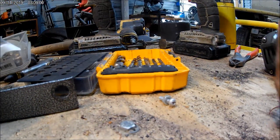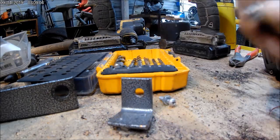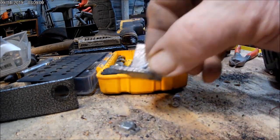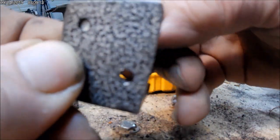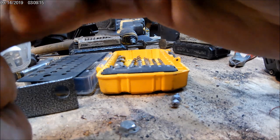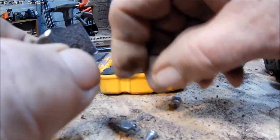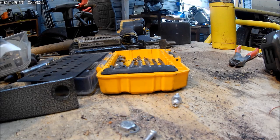What I'm doing here is I'm trying to make a little bracket, a piece of angle iron where I can mount the choke cable to the frame or the body somewhere. And I'm going to rig up a solenoid like a window door lock actuator. They're universal size, so they'll fit anything pretty much. They're not really made for any particular car.